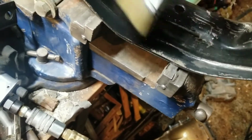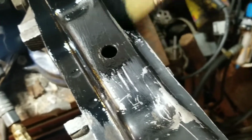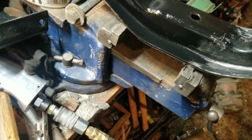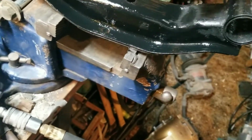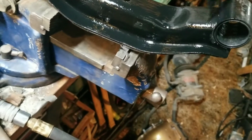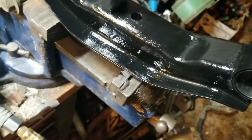Coating on pretty good. I know some people, everybody's got their own brand of paint that they swear by. Mine personally is Rust-Oleum. Been using this stuff for years. No, I'm not endorsed by them, but I've just had really good luck with it. It sticks real well, and I like the finish. I used to own an old Datsun 521 pickup, and living on a college budget, I was working at Osh at the time, and I ended up painting the entire truck using Rust-Oleum paint. I painted it an army green color. It looked really good. If you do paint prep properly, you don't have to use $300 paint to get a decent looking paint job. It's more about the prep, really.